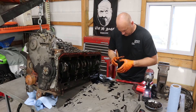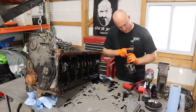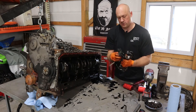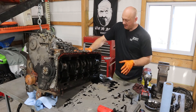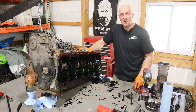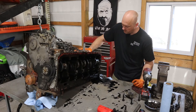Cylinder six — not looking good. Connecting rod is jacked too. I don't know why I'm so upset; I go into this expecting to find catastrophic failure, and then when I find it, I'm like, oh man, that's terrible. So we've got all the connecting rods pulled off. Cylinder six is our major culprit — this bearing is actually welded to the crank. The crankshaft needs to be replaced, and that connecting rod assembly needs to be replaced because it got torn up too much.